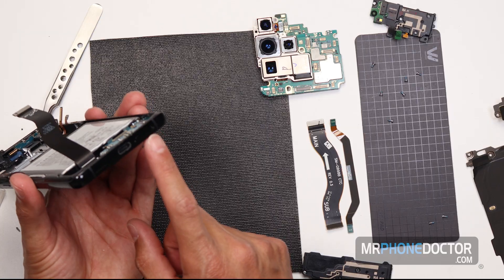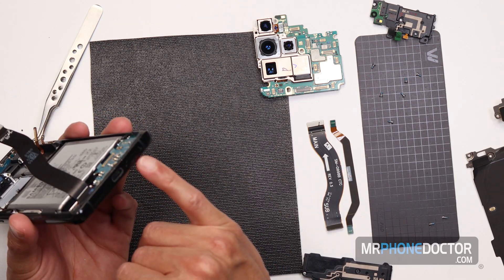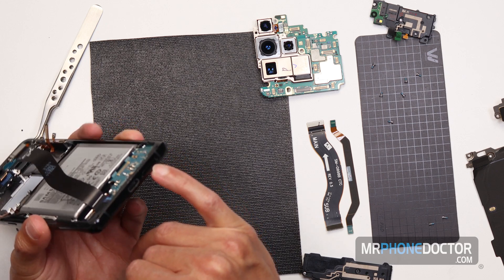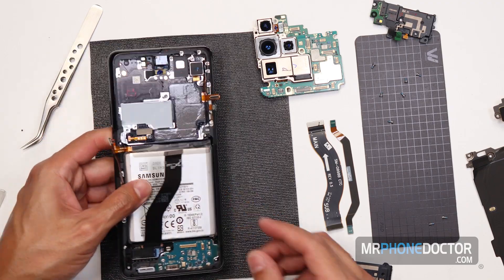One cool thing I did see with this one is the SIM tray. Normally you would remove the SIM tray when removing the logic board, but they relocated it down here to the bottom. So now your SIM is running all the way down here. Of course, if you do need to remove your charging port, your SIM tray does need to come out — make sure you dislodge that. They moved it down to the bottom. So that's pretty much the S21 Ultra teardown. I really hope you guys enjoyed it and got some useful information on how we take these apart without damaging any components. If you enjoyed this video, make sure you hit that subscribe button, smack that bell, and leave comments down below. We'll see you guys in the next episode. Cheers.